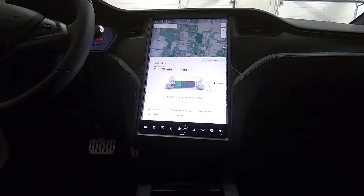Inside the Tesla, looking at our charging rates, we've jumped up to 16 amps and we're currently at 8 miles per hour. It will probably creep up to around 11 miles per hour. To get to my 60% charge set for daily driving, it says 15 hours — but this gives me a viable Level 2 option at 220V and I'm actually getting 16 amps out of it.